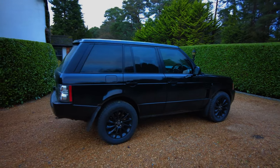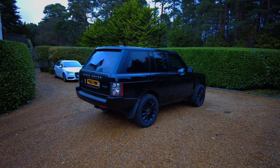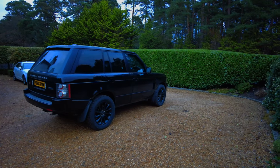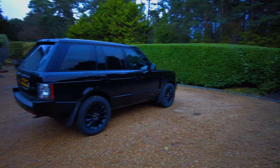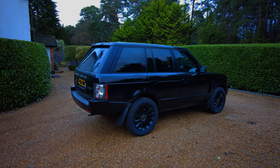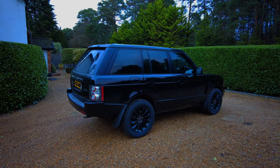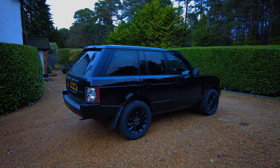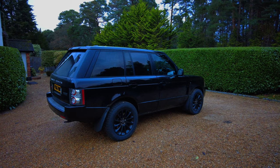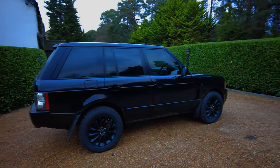I've got the Easy Lift suspension module in. With the L322s, they do not have the little jog dial extension on it. Because the ECU is in the back, basically underneath this filler tank behind the back of the fuse board, where you plug in the Easy Lift ECU, there is no extension to run it. So I've had to get creative: buy a new center console ashtray and extend the cable.